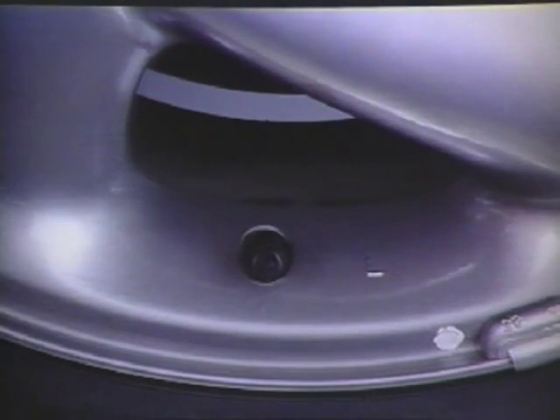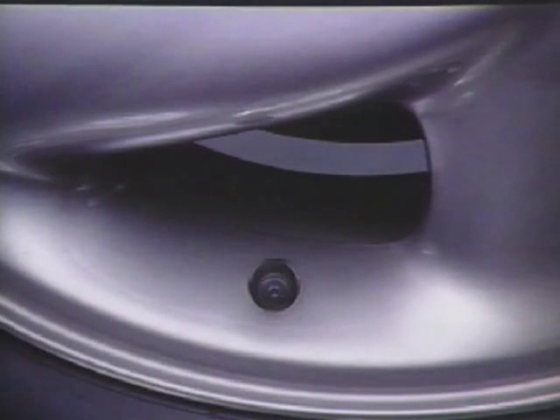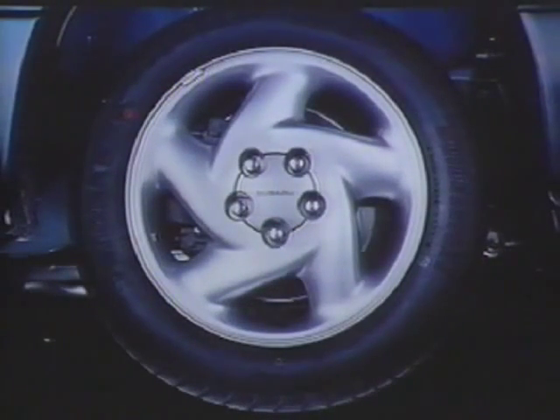The stylized aluminum alloy 16-by-seven-and-a-half-inch wheels reduce unsprung weight and contribute to vehicle stability, maneuverability, and improved ride comfort. The rims are also directional. The left side wheels are marked with an L next to the valve stem, and the wheels for the right side don't have any markings. The wheels must be installed in the proper rotational direction. In addition, the enlarged wheel mounting nuts use a captured flat washer instead of a bushing insert as on previous mag wheels.